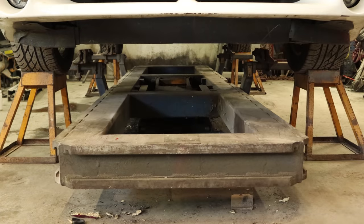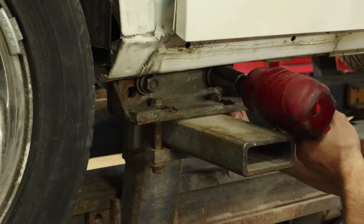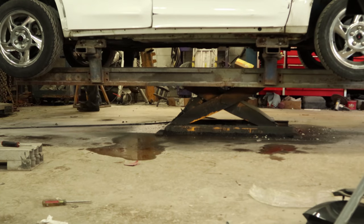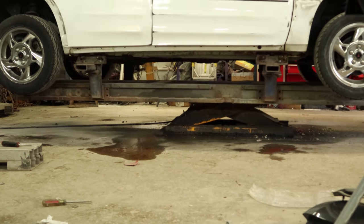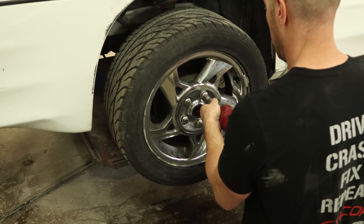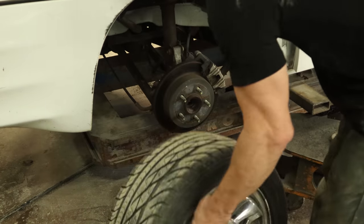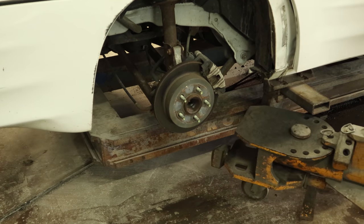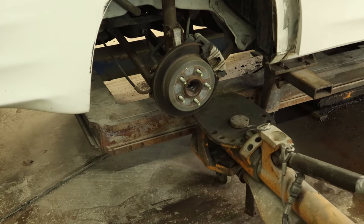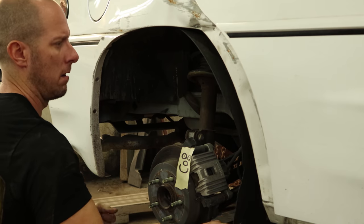We're going to leave the one on the driver's side. Now that the clamps are there, we can raise it up, clamp the clamps onto the pinch weld, and remove our stands. Now we can pull our ram into place. Better remove the tire so we can get it in where we need it. Raise the lift up a little bit, get it to the right height, slide it onto the frame rack, and hammer the wedge in to lock it in. Now we can pull the wheel liner off the right rear — one bolt and a couple little plastic clips.